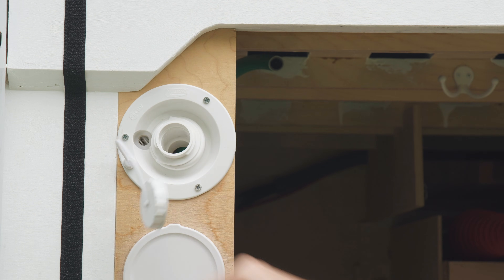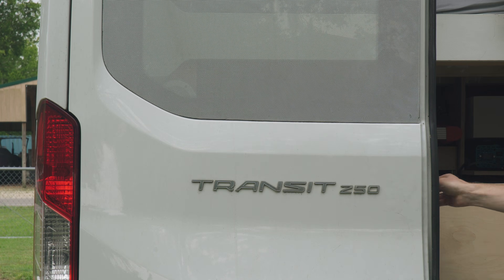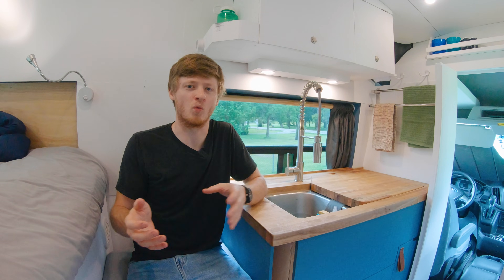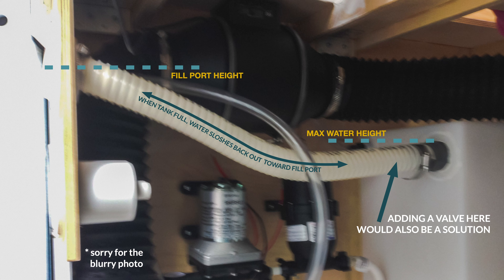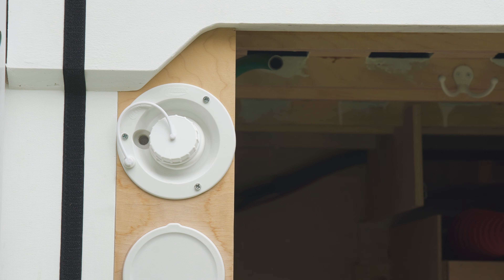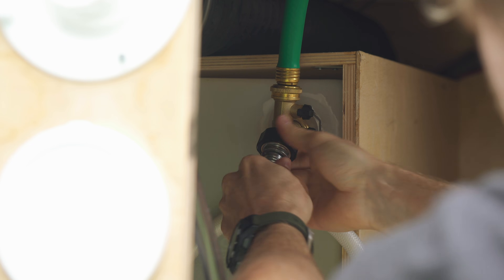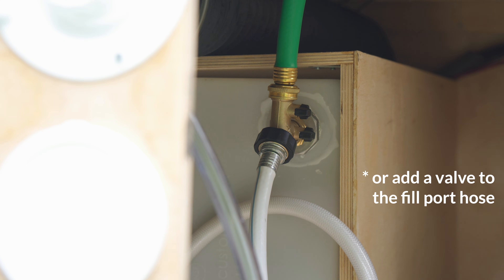The easiest way to fill a tank like this is by adding a fill port. These can be mounted on the exterior of the van, but in my case I didn't want to cut another hole in the van or have it showing on the outside, so I opted to mount it inside just inward of the rear door. I made a mistake though — I didn't get the fill port mounted high enough above the top of the tank. This means water can splash back out through the fill port while driving or going uphill, partly because the cap also doesn't seal tightly enough. If the fill port were on the exterior it wouldn't matter as much, but on the inside you don't want this. I got an adapter to hook the fill hose directly to the tank, but I don't think that's an ideal solution. What I'd recommend is using a fill port, just making sure it's mounted high enough and has a cap that secures tightly so water can't splash out.